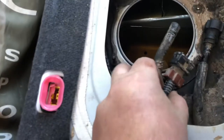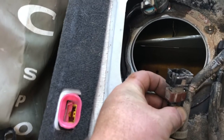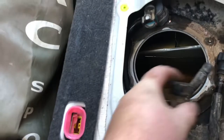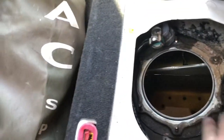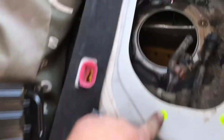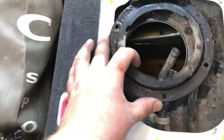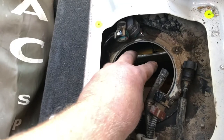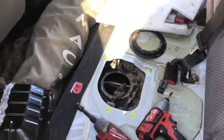Here are all the top connections. This is the fuel vapor pressure sensor — I undo it from the top, otherwise it makes getting the slip ring undone a pain. There are four screws — one, two, three, four — they're bright green. And there are eight millimeter bolts that hold this ring in, holding the FSU down inside the tank.